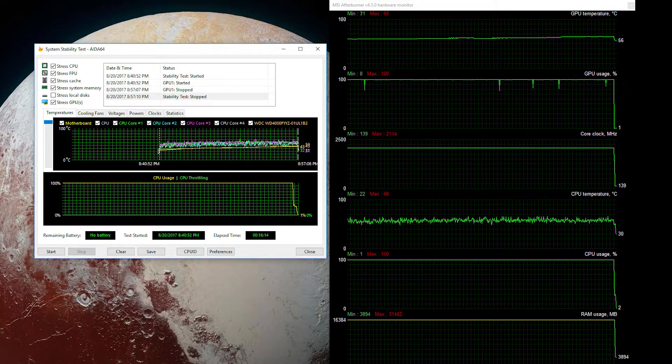The next one I tried was all the fans pushing into the case — so that means all the fans into the case and only pushing it out the bottom. It gave me 66 degrees Celsius on the CPU and 65 on the GPU, so 65.5 average. It's not too bad for this case. The only problem is when all the fans are pushing in, the actual case gets hot — you can actually feel the temperature of the aluminum face; it gets warm to the touch.